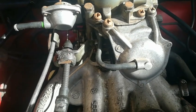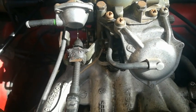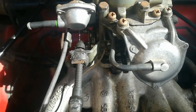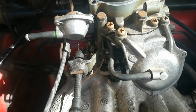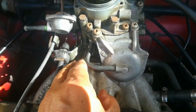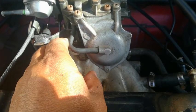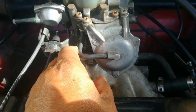Firstly, what is the second stage and what does it actually do on your carburetor? The second stage is a function on the carburetor which kicks in when you're accelerating on the road — between two and three thousand RPM the second stage kicks in. The exact RPM I'm not exactly sure about, so don't hold me to it; I'm just going on experience with my Golf Mark 1. The second stage gives you an actual power boost as you reach that certain RPM, the vacuum kicks in, and it opens up the butterfly — giving you a little boost as you go through your gears.